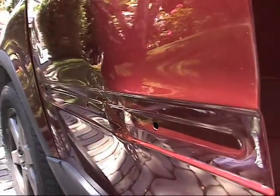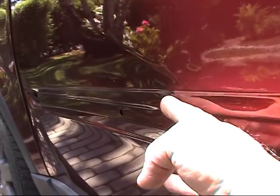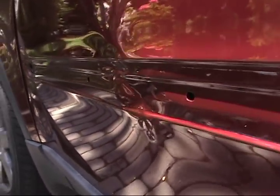Okay, so I couldn't really get that crown down because you really have to put wedges inside here to knock that down and make sure you don't hit the brace. What's ideal about doing a dent like this is you have so much you can hide inside this inset, because that's where the molding goes. And that's why every job is so different. When you can camouflage work inside here with trim work and molding, that helps a lot.